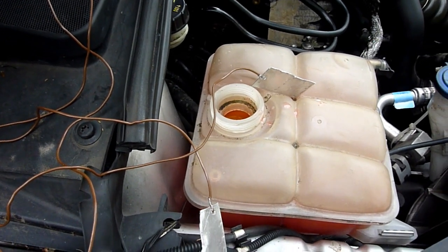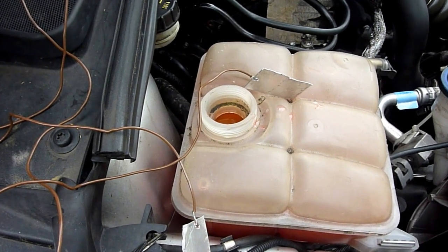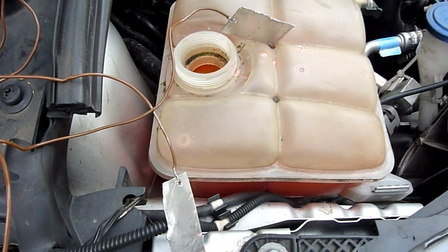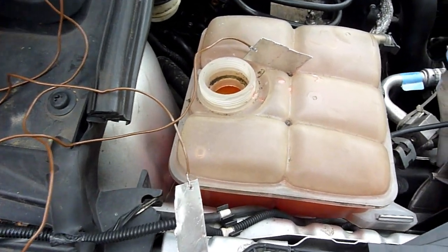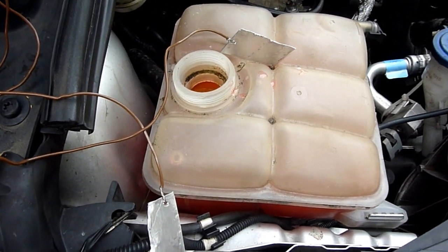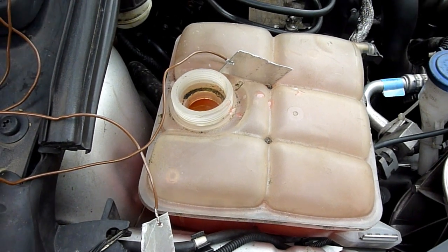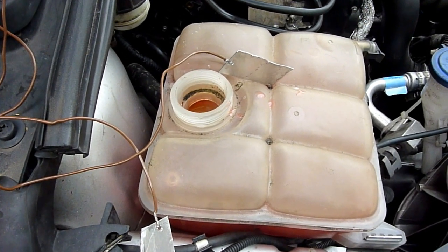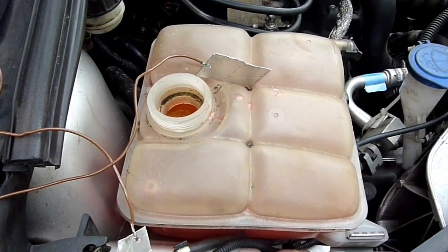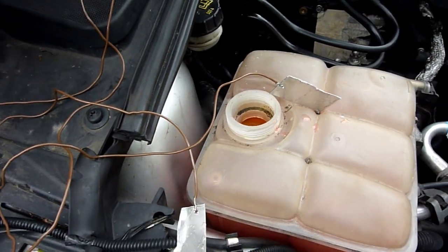I don't mean to be like, you always have to have, in science you always have to have a scientific prediction. Have an idea of what's going on, test it, find out, make a conclusion. That's my conclusion. Use distilled water, use de-ionised water in your car's radiator in conjunction with ready mixed. If it's ready mixed antifreeze, then you don't have to bother, because they use this stuff anyway. If it's like from concentrate, then don't worry, just chug it in and look, stops your car's engine from rusting.